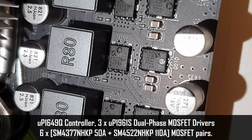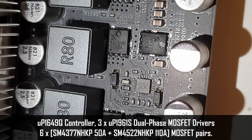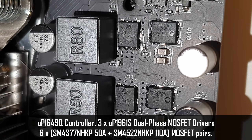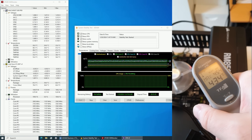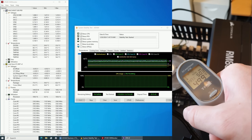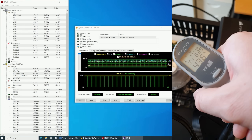Now let's talk about the VRM. Under this minuscule VRM heatsink we have basically a copy-paste from the Machinist X99 RS9. The only difference is that one of the MOSFETs was upgraded from 48 to 50 amperes. With such a configuration the VRM overheats and cooks itself rather quickly under severe load. I decided to test it using a box-style or flower-style stock cooler, which disperses air all around the CPU. The air flows from the CPU cooler directly into the VRM heatsink, blowing through the VRM and cooling it. Testing with the E5-2697 V3 with Turbo Boost Unlock, after 30 minutes of AIDA64 stress test I measured up to 70 degrees Celsius. So even though the VRM is not optimal, with proper cooling it is possible to keep it cool.